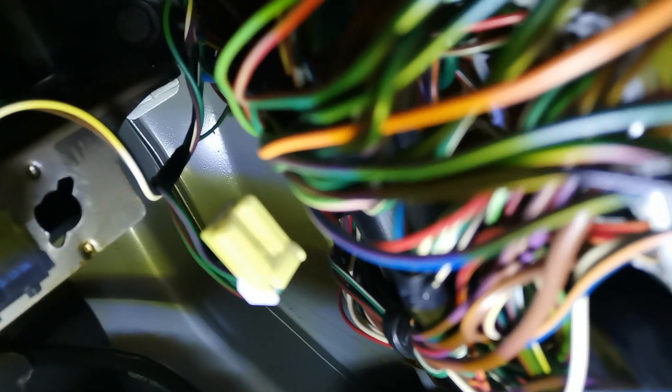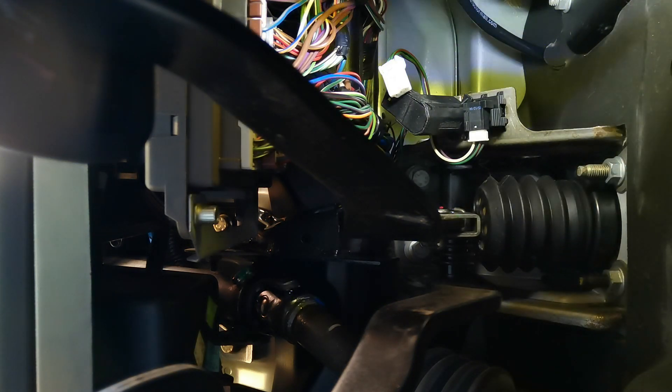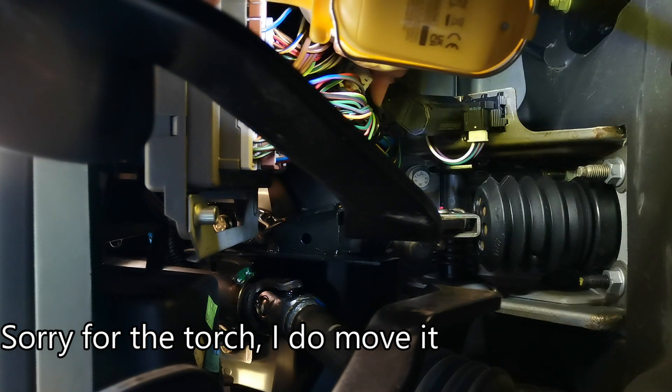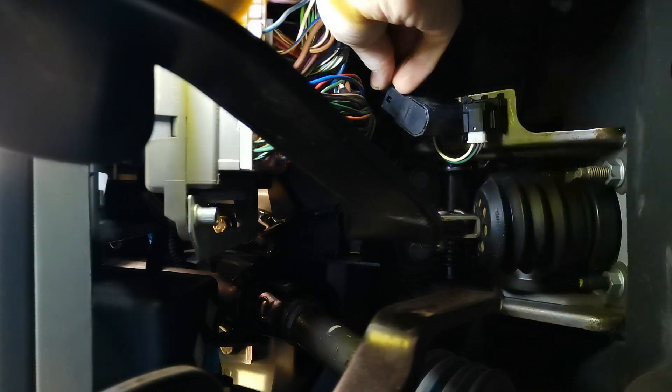Like I said, I'm going to be using the phone screen for this, so I do apologize if I'm fumbling about a little bit. This is the hole that it leaves — the two prongs and the circular hole. On the switch you've got these two legs; one goes into each of those prongs and it turns up in. I might not be able to record myself getting it in because it's a bit awkward having the camera on the floor. I'm doing this all backwards to myself because the screen mirrors everything. Then it just clicks in and the sensor is replaced.